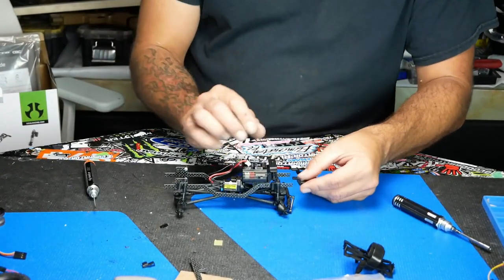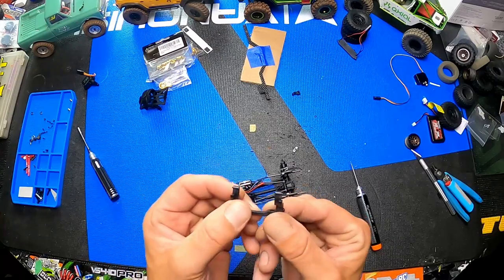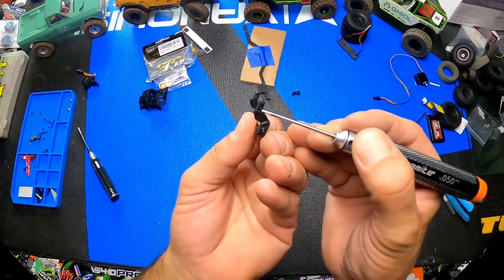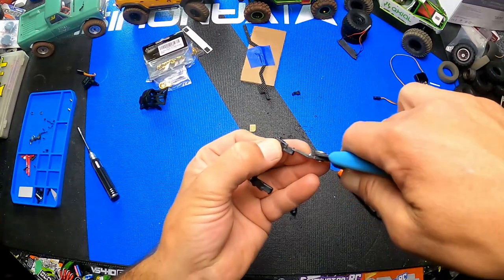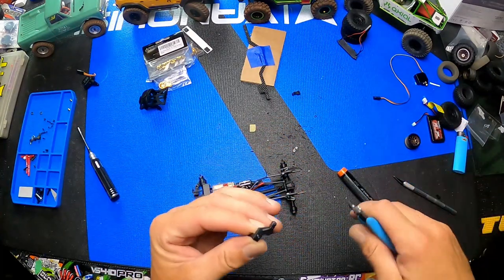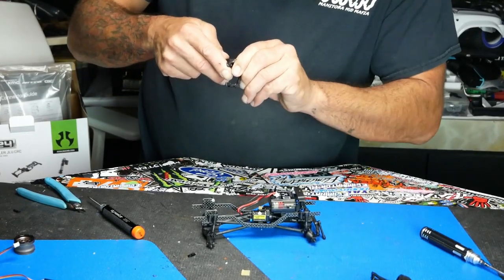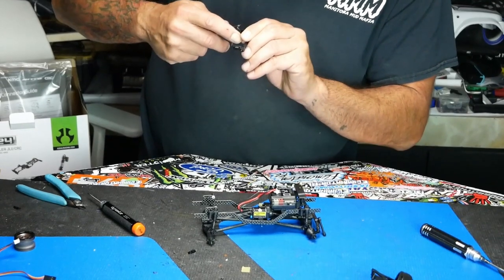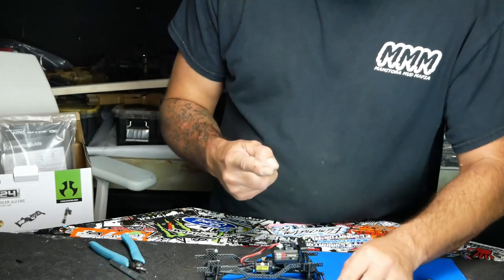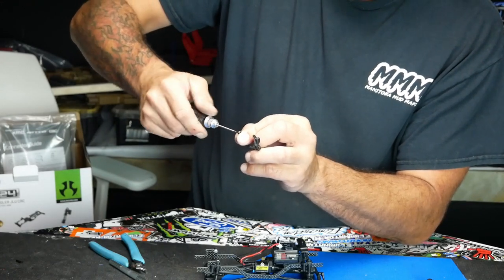Front crossmember — now this fit into the frame rail right up to that line on both sides, so we need to trim that back at that line. And since we cut that back, we want to go through and re-tap those holes just with another screw so you're not trying to fight what you're doing on the chassis, because that sucks.